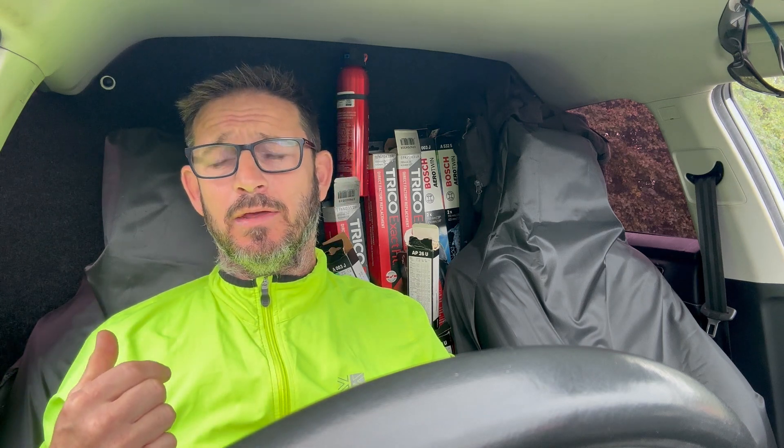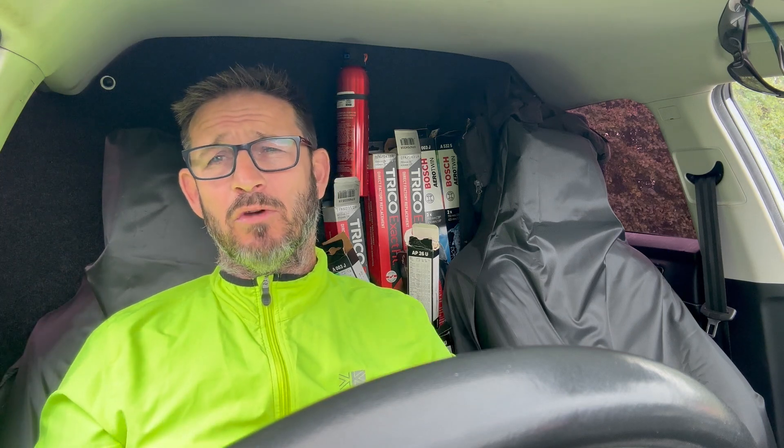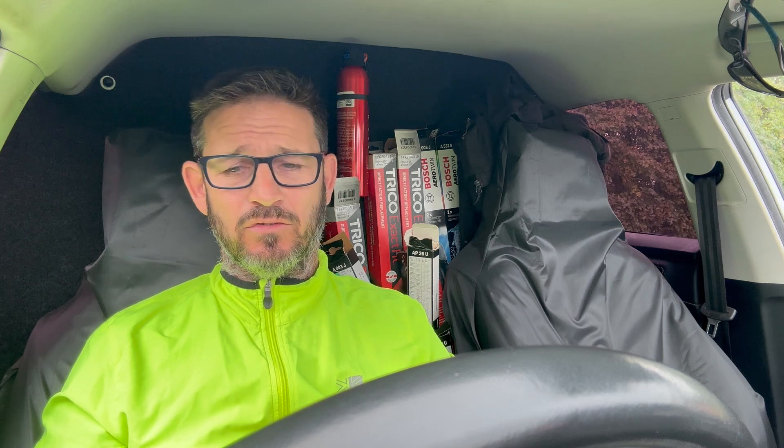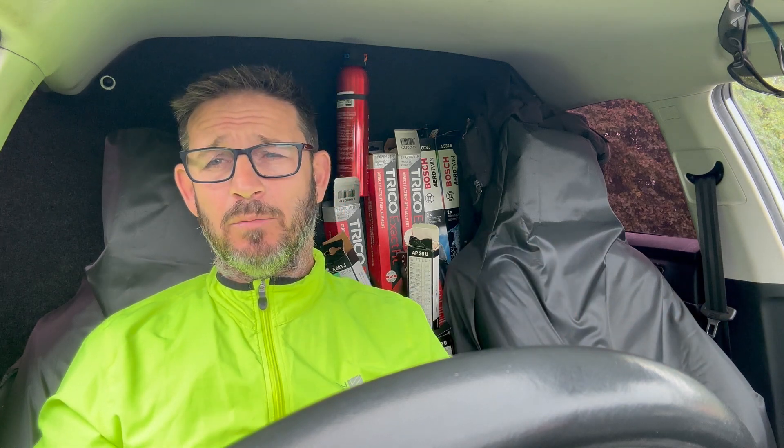What I'm going to do now is get the near-side front and near-side rear wheel off, open the calipers, have a look at the pads and discs, and run a bar around the suspension to see if anything's knocking. I'll do the near side because that gets more wear - if you're likely to have anything going wrong, it tends to happen on that near-side front wheel.